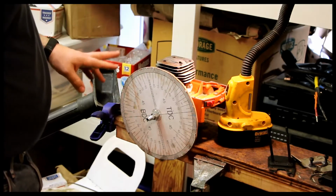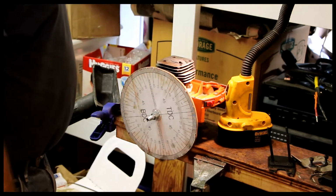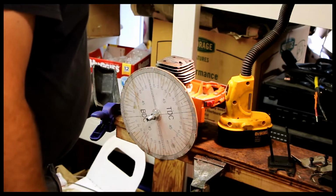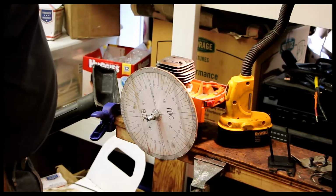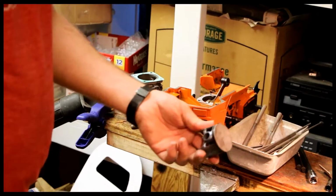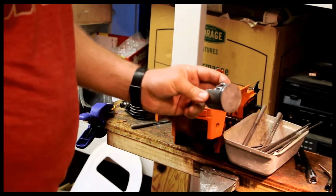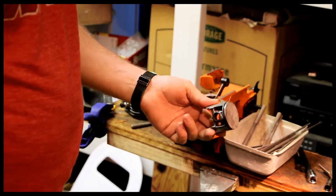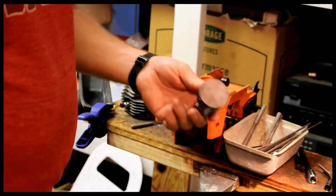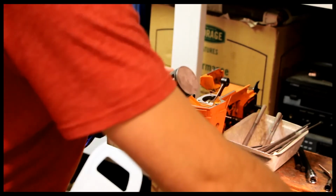Next thing, I'm going to goop up the gasket and put the cylinder head home here. At least that's the idea. Cylinder's ready to go. Got to make sure the piston's ready to go with a new ring. So here's where we're at today. I've got the 262 XP piston here, pretty much ready to put everything together. I need to put a ring on this, so I'm going to do that. I got a little bit of oil on there.